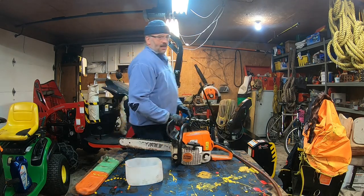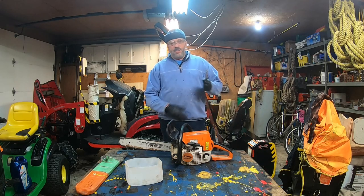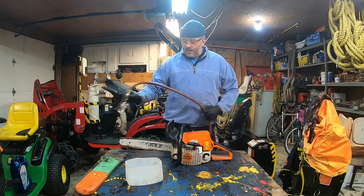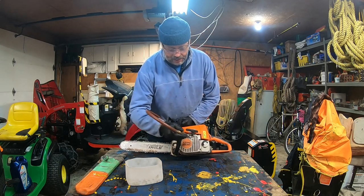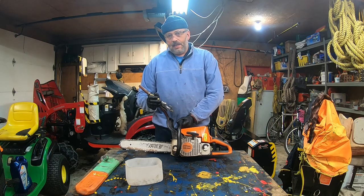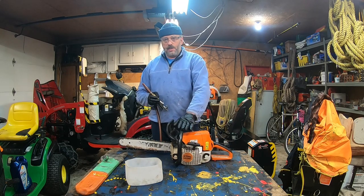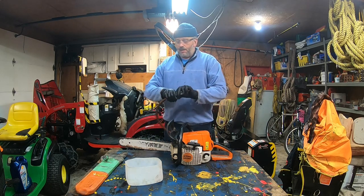All right, so stick around, I'm going to explain in detail what I do about my chainsaw, okay? The very first step is I use compressed air to remove all the dust all around. I start from the front all the way to the back and then all around, but especially the cooling crankcase, because it's very important that the blower works well so it cools down the engine, because these are air-cooled two-stroke gasoline mix engines. All right, so I'm going to proceed with that.